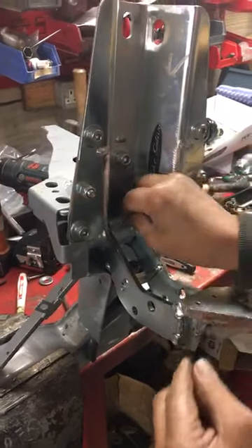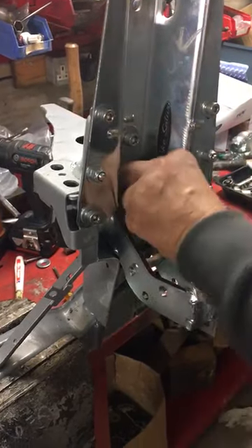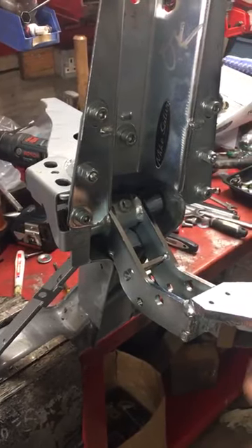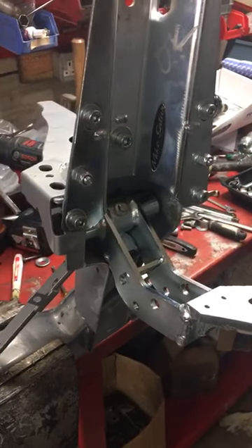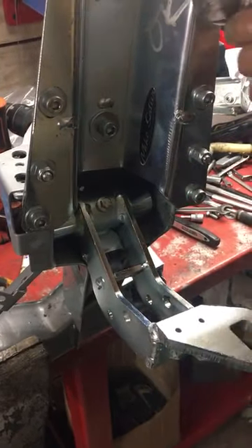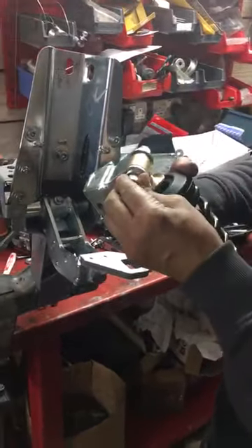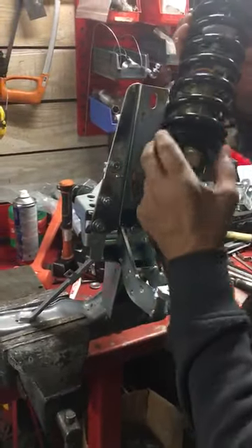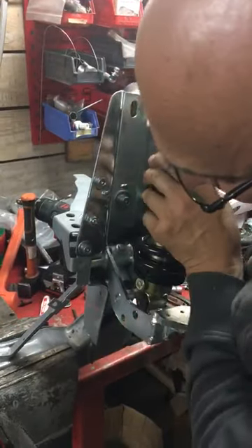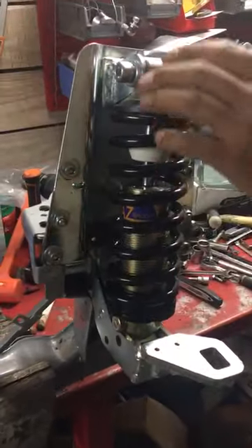Insert the little screw and seal — nothing's torqued up fully but obviously top that up. Shock absorber and spring assembly with the top mount assembled, place that, make sure the spring plate platform is fully down. Lube this a little bit if necessary, push that right down so the shock is as far down as it can go.